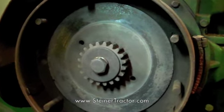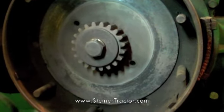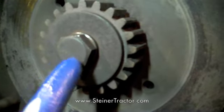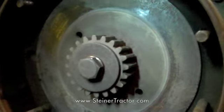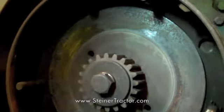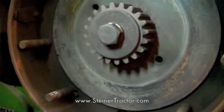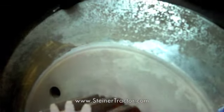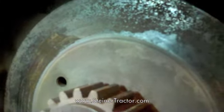All the clutch facings are off. Now we're looking at the clutch pulley and the clutch drive disc on the end of the crankshaft — on all models this bolt threads into the end of the crankshaft. There is a clutch facing on the backside of this drive disc, between the pulley and the drive disc, that is often neglected and forgotten. It's not uncommon to find those facings in pieces. In this case we see rust pitting on the wear surface of the clutch drive, and the double bonded disc that went against it was rather worn — the rust pitting would cause that over time.